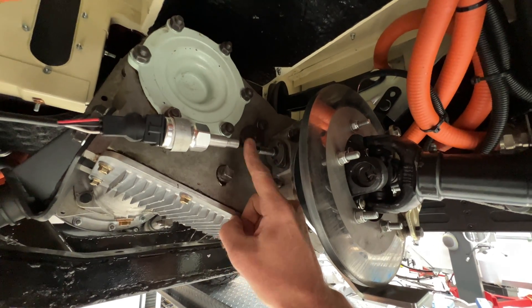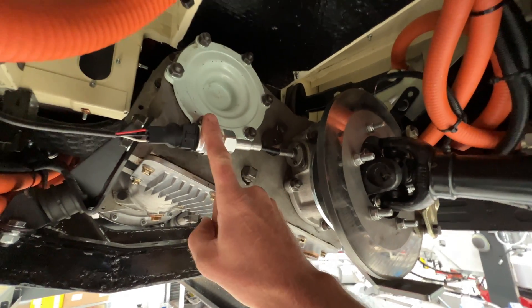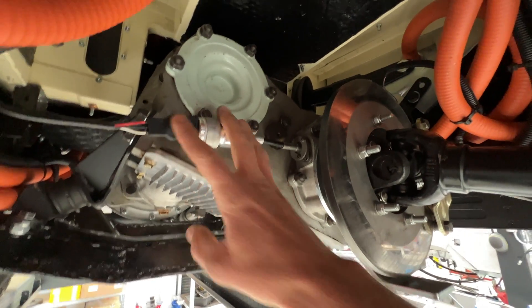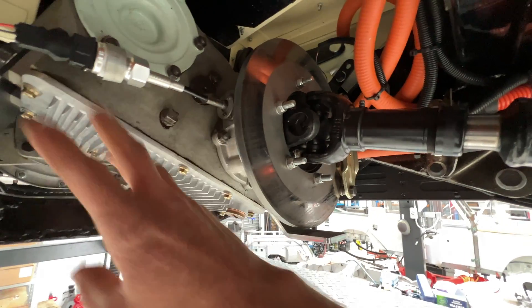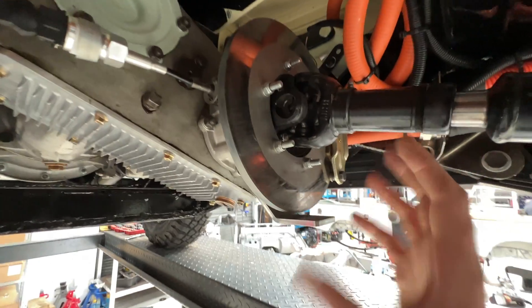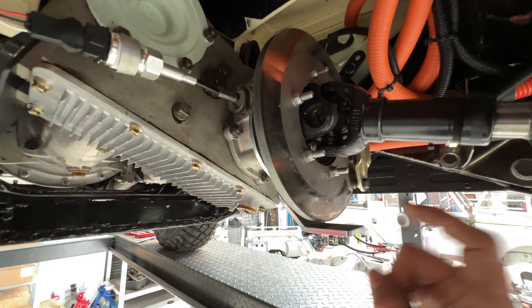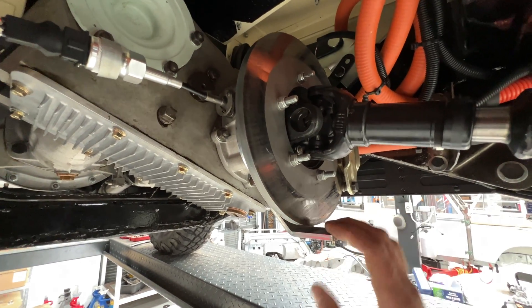The cable drive is about that long, and then we transfer to a digital signal at this point, which helps drive the modern gauges we use and stops any play and flutter. There's also a disc parking brake — without engine compression, that's the only thing stopping the car when it's off. It's a much better system; yes, it's a little more prone to dirt and mud, but it works much better when it's on, and it's very easy to adjust.